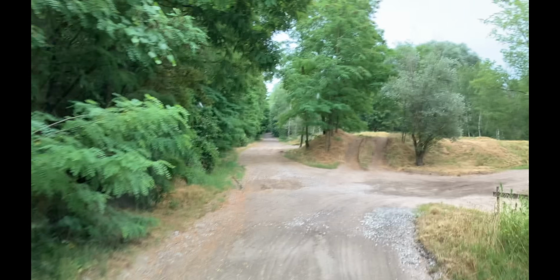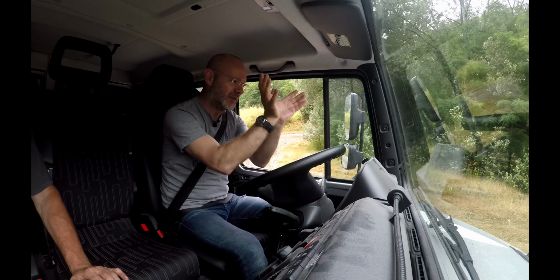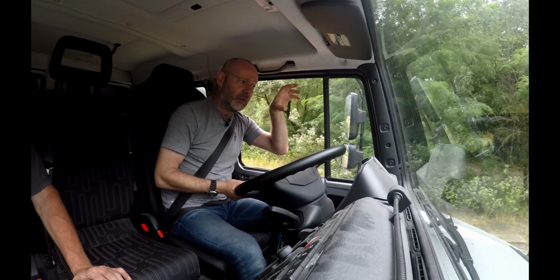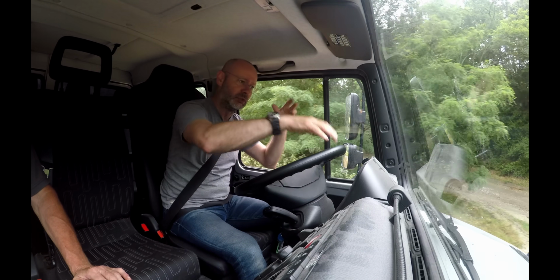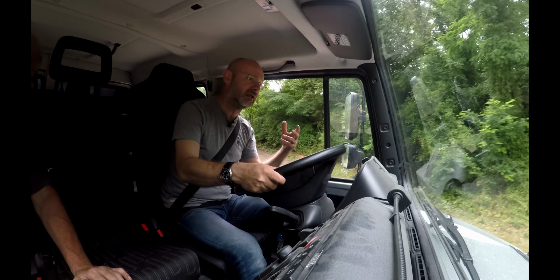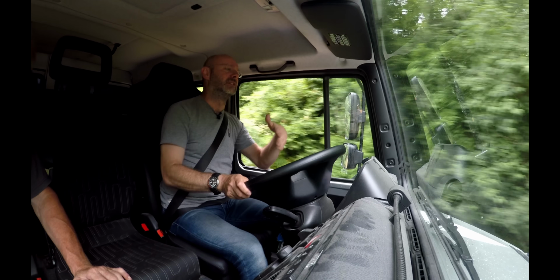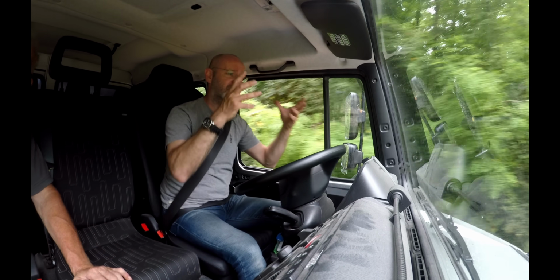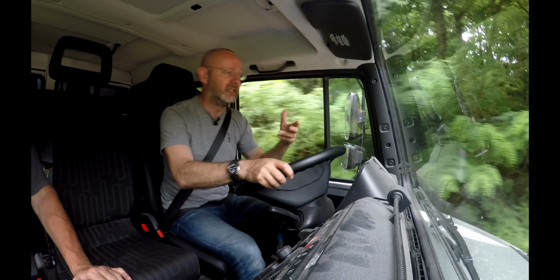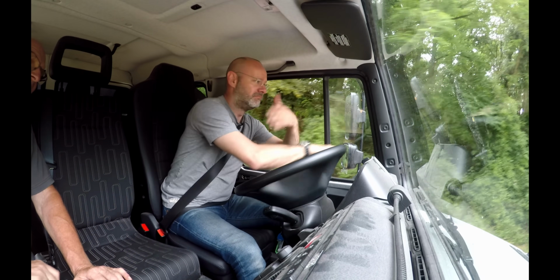And the body on the back is kind of mounted on a sort of separate subframe. You'll see it's just sort of mounted on a little B thing and supported on either side, which means whatever the chassis is doing, that load on the back isn't subject to any torsional changes itself, which if you're carrying sensitive electronic equipment, or you've got a big, these are pretty popular with firefighters, if you've got a 4,000 litre water tank on the back, it is quite important that those things don't flex because they need to be tight, and electrical equipment needs to be insulated, so whatever you've got stays.